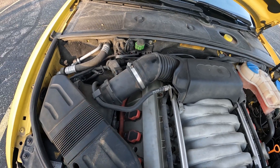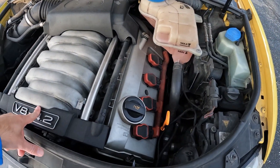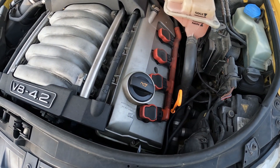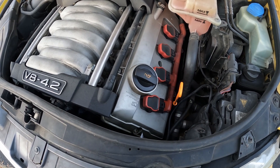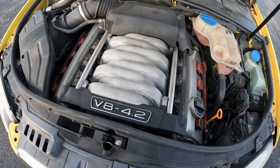It was like $220, so this had to be replaced. This engine has a lot of oil leaks — the valve cover gaskets had to be resealed, and the oil pan had to be resealed around the transmission because it was leaking oil, so that had to be fixed.